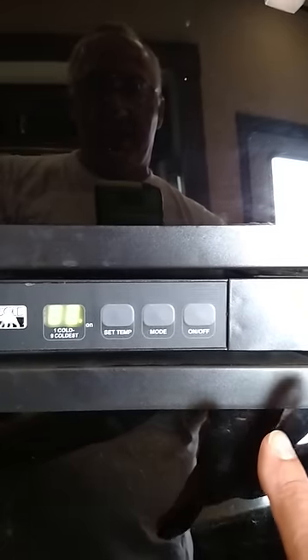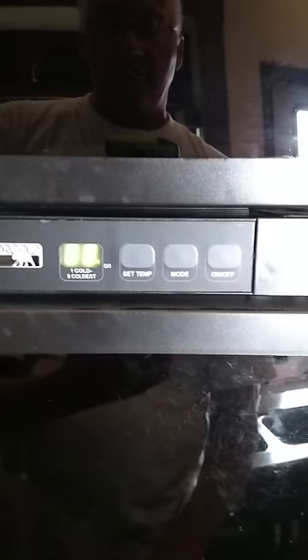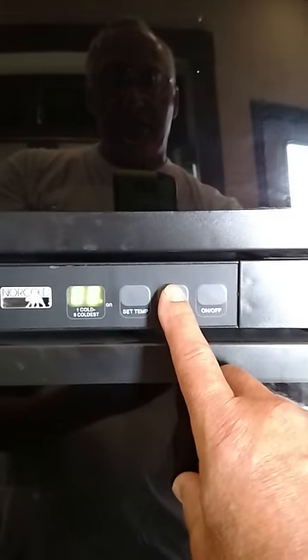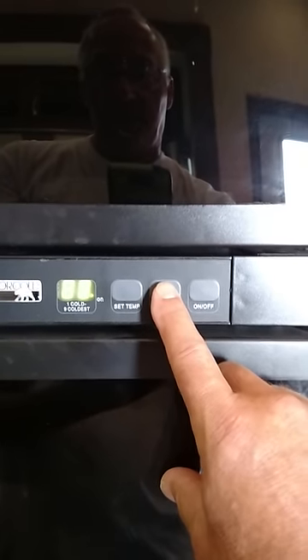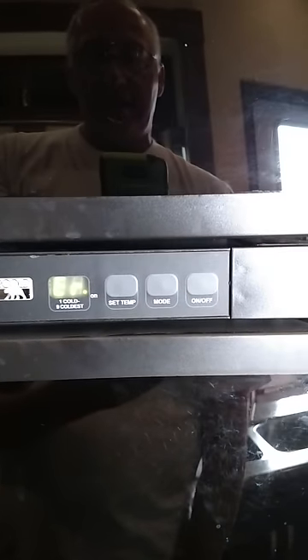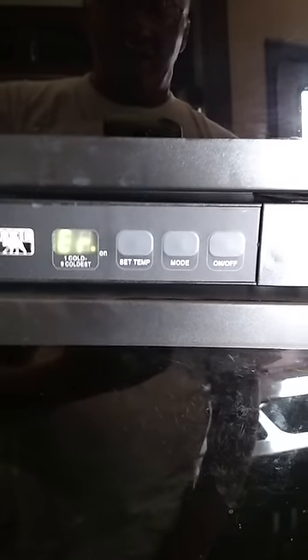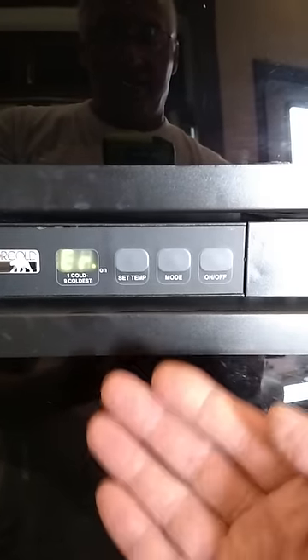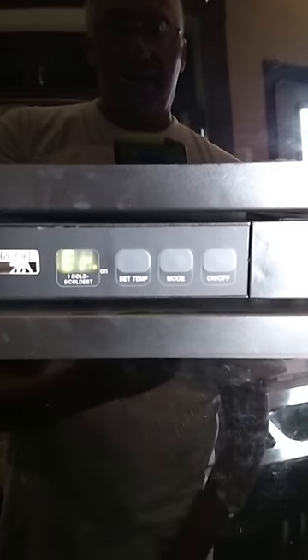There may be error codes in here. There is a page within the diagnostic mode where you can clear errors. Usually I don't care if there are errors — I just know that I want that temperature to change. I'm going to go to page number six, so just push this until number six shows up. And you'll see that ER shows up, which means you're on the page where you can clear any errors. If you use the PDF file — I'll put a link at the bottom — you can see the error codes displayed. You can go through that and look before you clear them, because once you clear them, you're not going to get them back.